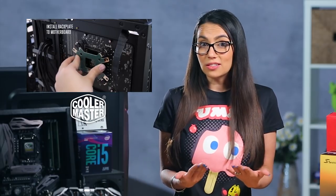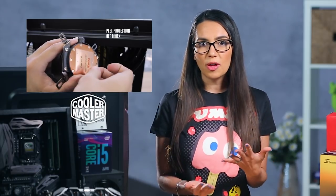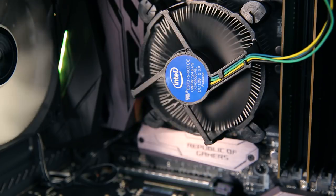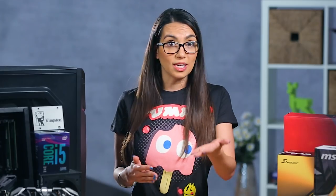If you're using a liquid cooling solution, you may have to install mounting hardware on the underside of the motherboard or set up a universal support mechanism — again, all great reasons to do this outside of the case. The most common thing that can go wrong while installing the CPU and cooler is overheating. CPUs get insanely hot very quickly, so an improperly installed cooler or booting up to see if it works before installing the CPU cooler can both be fatal.